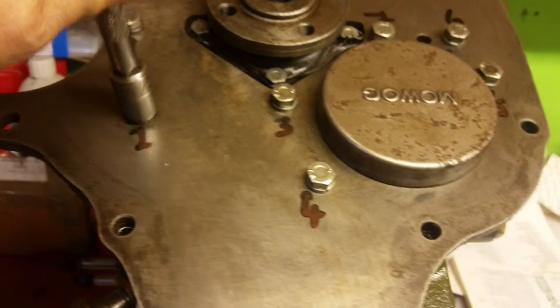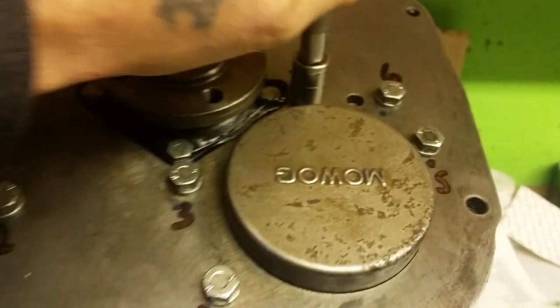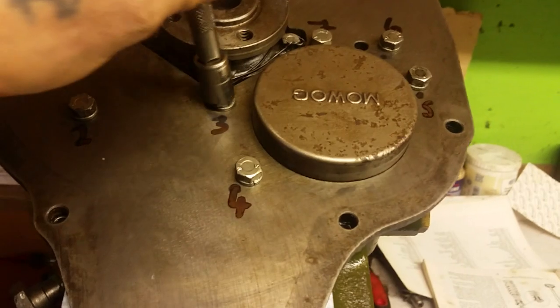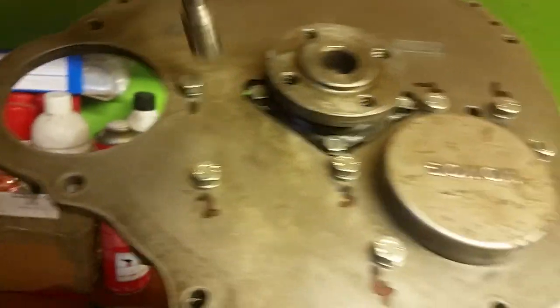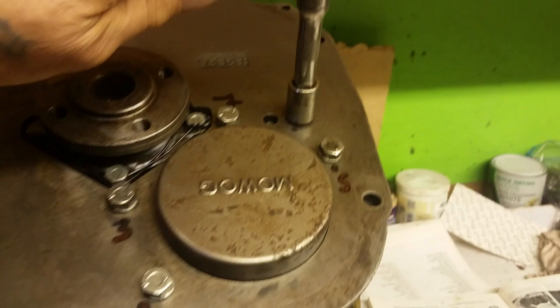And then you'll learn that, especially with a cylinder block, there's a set method to torque them down, to tighten them down. So just go around them all. This is getting a bit difficult now because I'm only one-handed, but what I shall do then, for the engine back plate, is look in the torque settings.